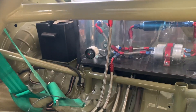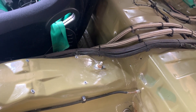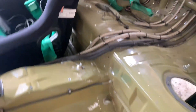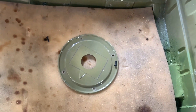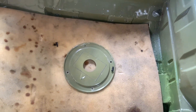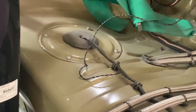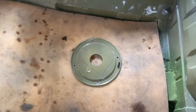The wires from the fans are going to come in right between over there and we're going to route them all the way to here. The regulator for the fans is going to have a ground bolted to that bolt, so it needs to be really strong. This is the little lid we're going to put over there, and it's going to take the rubber grommet — not one we made, but the original rubber grommet — and now we're going to use it to put the plug of the electric water pump through there.